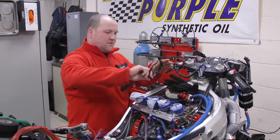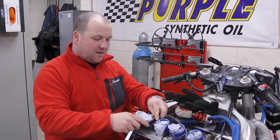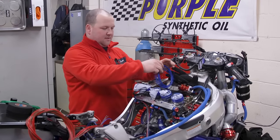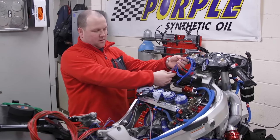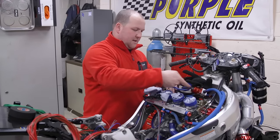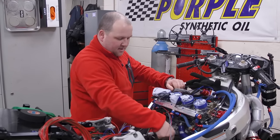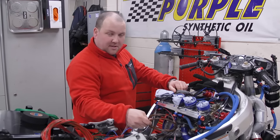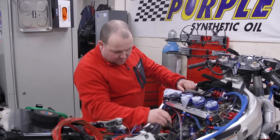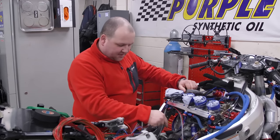That there is the plastic pipe — that measures how much boost goes into the motor, hopefully that'll be a lot. Then we've also got these wires here, same again: one, two, three, four — and they're for your coils. This here is for your cam sensor, and we've got your main ground which bolts to the block somewhere — we'll bolt that probably to the back of the starter motor where the main earth is anyway. We also have a coolant temperature sensor and a gear position sensor.